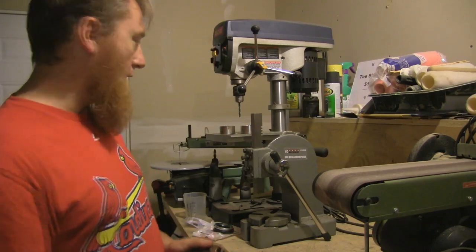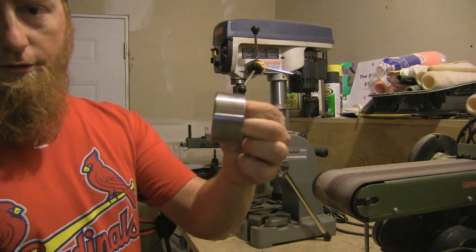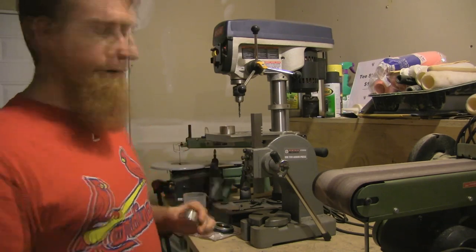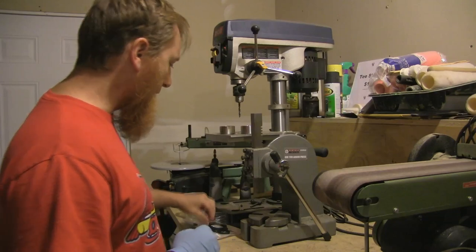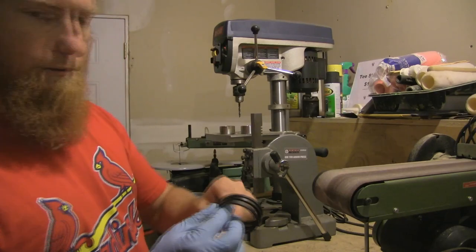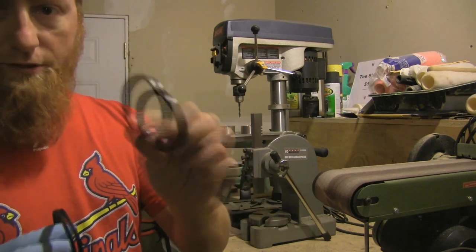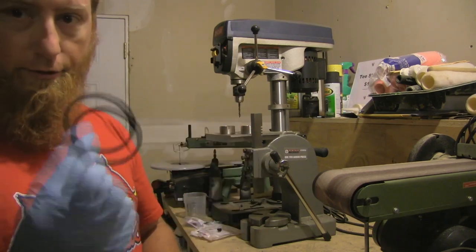Just be real careful. If you're replacing your pistons, I've got brand new stainless steel pistons that I'm using, so I wasn't caring about tearing up the old ones — I'm just gonna chuck them in the recycle bin. Now, the first thing I figured out is that the little seals that come in your kit — there are actually two different ones. There's a slightly thinner one and a slightly thicker one. The slightly thicker one goes up underneath the dust seal; the slightly thinner one goes inside.